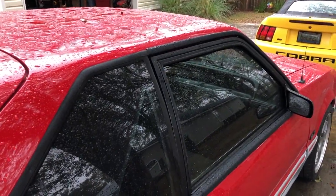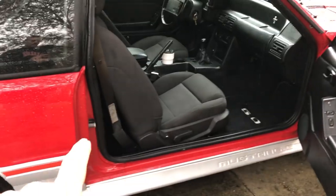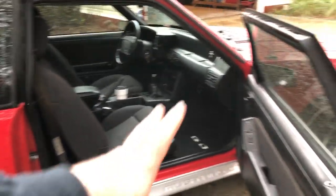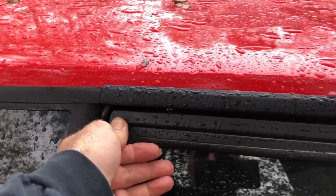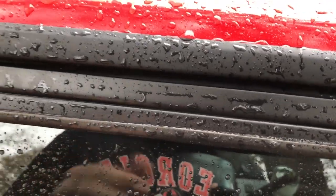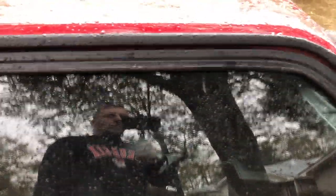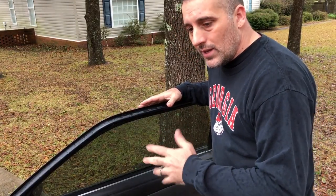There are ways to adjust the window, so I'll go ahead and cover that real quick as a reminder of how to adjust your windows if you're getting leaking. First, make sure that your striker is adjusted properly. Once you do that, check and make sure your door seals up. If your door does not seal up, you can come on the outside and push to see how much flex you have, or put a flashlight in under there and look to see if there's any light coming through the seal.